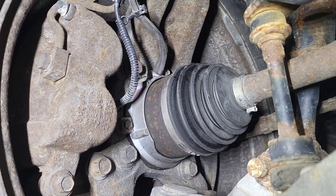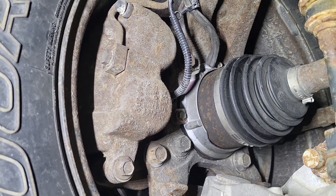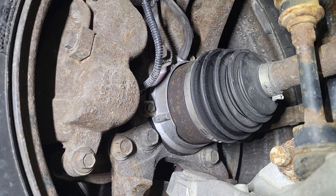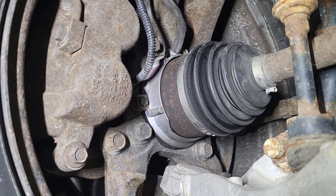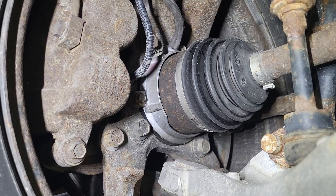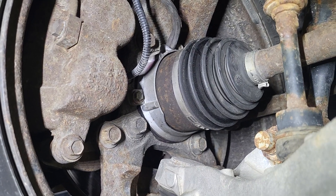Good afternoon shopkeepers and do-it-yourselfers. We've got a 2005 F-150 making a racket when you go to accelerate. It only does it when you're driving - doesn't matter if you're going forward or reverse - and it sounded like it was coming from down low. I determined that it was one of these four-wheel drive actuators.